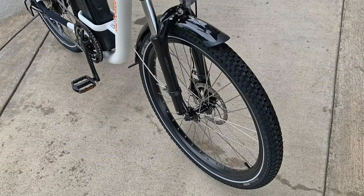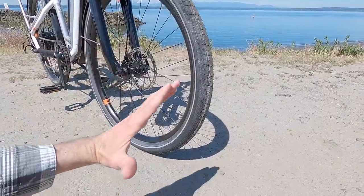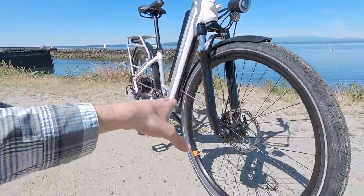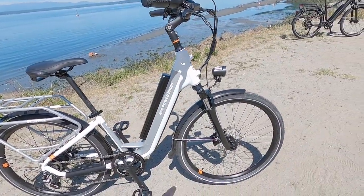The old tires were slightly wider with a checkerboard pattern. This is a lot smoother, quieter, more efficient. Having a larger wheel gives you a lower attack angle — it's a little bit smoother. It does raise the bike height just a little bit where the axles are, but having this lower standover height and actually a slightly shorter travel helps.